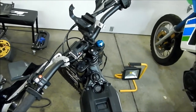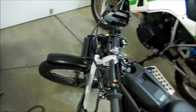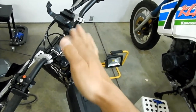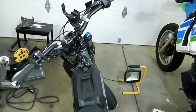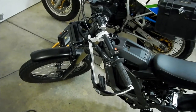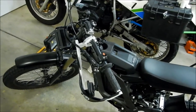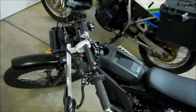I haven't done it on this bike yet, but I can show you how to check if you have a loose headset bearing — and that's what I believe I have on this bike. That's why the front feels unstable in corners, like it wants to lift, or the wheel feels wobbly. It's kind of hard to test for play on this bike because it has a suspension fork, unlike a road bike where nothing moves in the front.